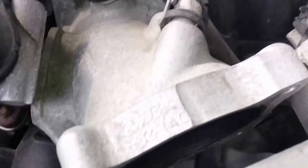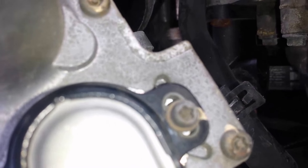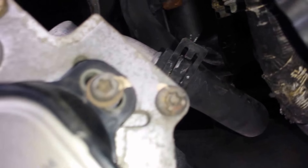I'd rather not. It's really dirty in there — throttle body needs cleaning — look at that, all black. I'll probably get a throttle body cleaner just to wipe it off. This is where I get the sharpie. You can see a white dot going from the screw onto the TPS sensor and onto the throttle body — three white marks just to show how they align. I'll use a sharpie to draw the outline and hope the replacement follows the same path.